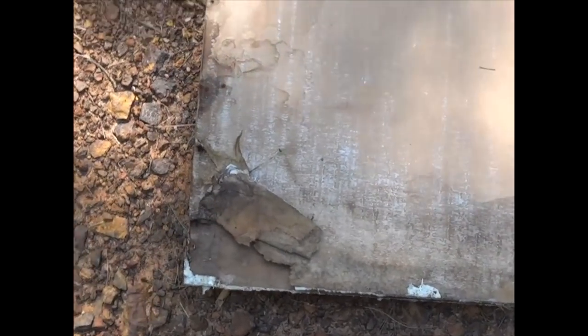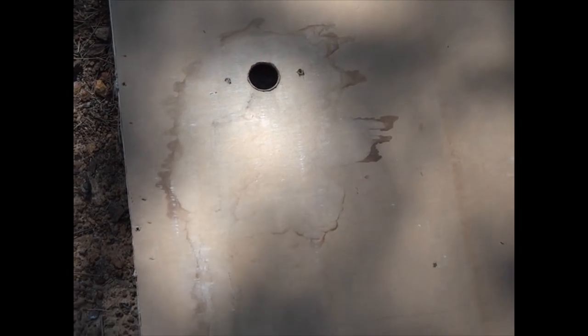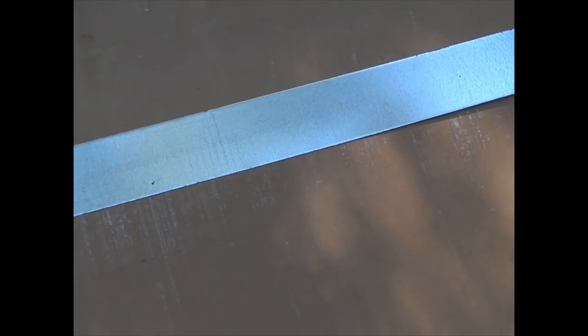See, this is where a utility light was on the front of the trailer — a little bit of water leakage there, quite a bit over here, all the way up this side. You can see the water staining. This is where the marker lamps were — a little bit of water staining there, same thing on the other side, not quite as bad. What's interesting is that in this middle section where most of the delamination was occurring, there's very little sign of any water leakage whatsoever.